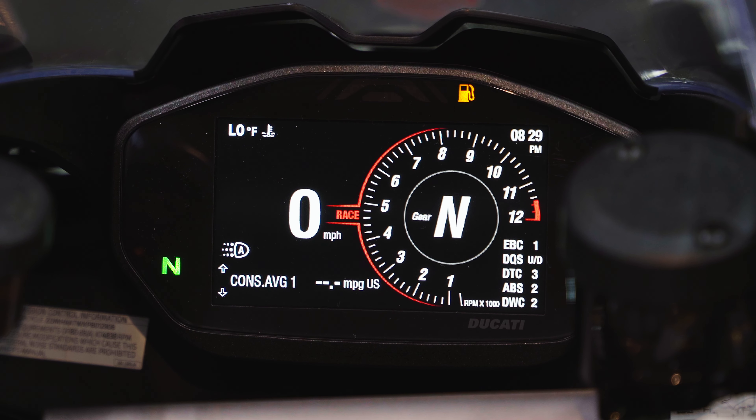The green light on the far right is your daytime running lamp indicator — it's a bit counter-intuitive: if that light is on it does not mean your headlights are on, it just means the DRL is on. There's also a small headlight icon with an 'A' in the middle indicating the DRL is in auto mode. Top left of the dash shows your engine temperature, below that is the speedometer, and if the kickstand is down it will indicate that. Below that is the DRL indicator, and then the information window you can scroll through with the up/down switch.